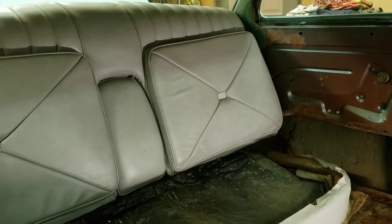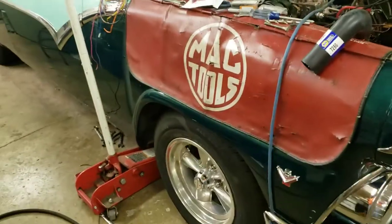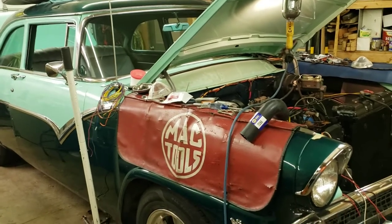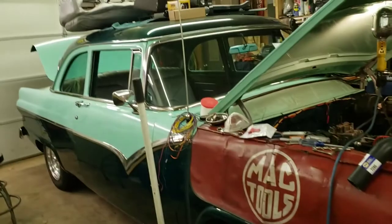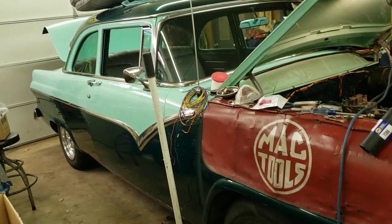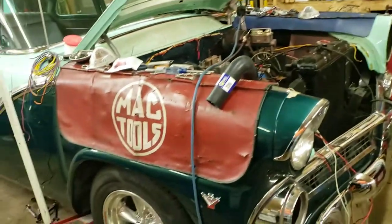The wiring is what brought it apart this far — I can't work with garbage wiring. Brakes have been done. The transmission — he was in there resealing it, I put fluid in it and drove the car, but it's got another leak. Maybe there's something he missed, or maybe he didn't change the seals and I skipped ahead and added fluid when I shouldn't have. That's what happens when someone passes away and doesn't tell anyone what they've done — you find out the hard way.